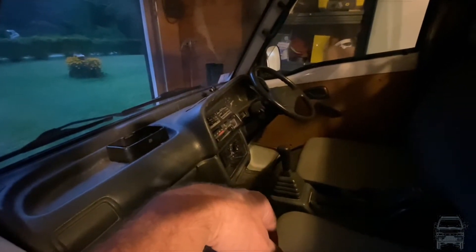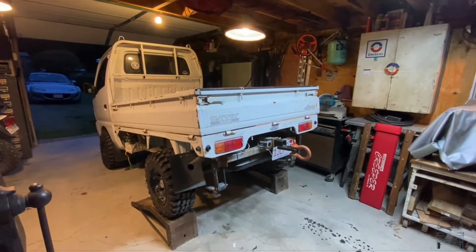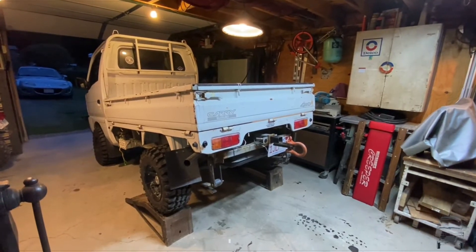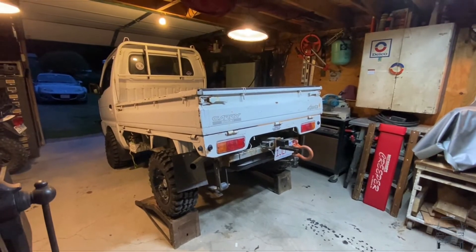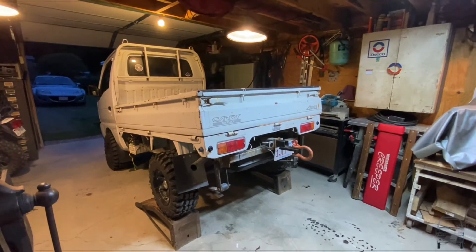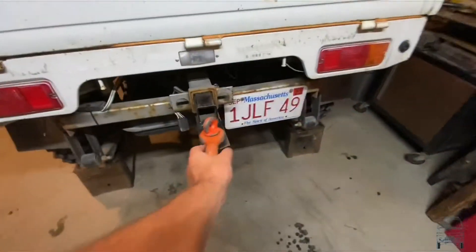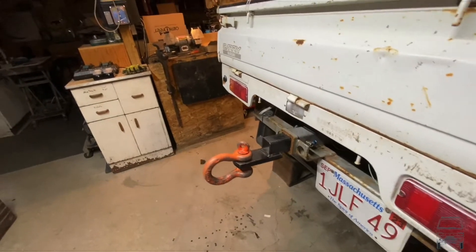While I didn't get this fixed and all I did was cut a bunch of wires that were actually fine, it did help with diagnostics because the voltages were just too low — it should not be pushing six volts there. So I know I'm getting some kind of problem with the relay up front. On the bright side, I do know now that my hitch can suspend the weight of the vehicle very easily.